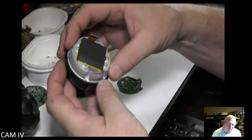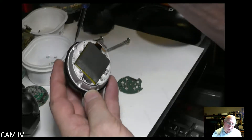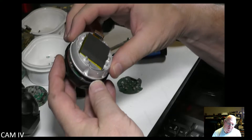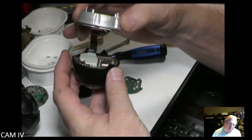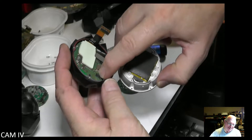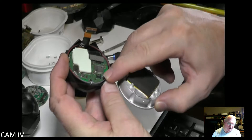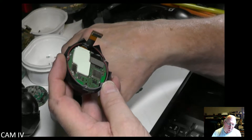You see your battery here. With that, your second layer assembly has five screws that hold it in place. I've got all the screws out of here — this cable here, bring that up gently. Your battery cable will be connected to this connector here, same way as the HD. It's a snap-in connection, not a slide-in, so you would lift it from one side underneath the connector to snap it out. Putting it back in would be the reverse process, obviously without the screwdriver.